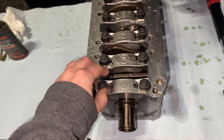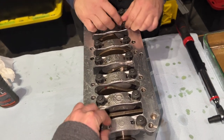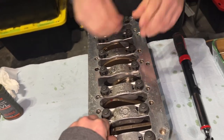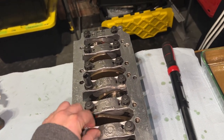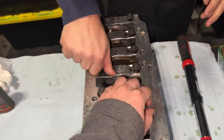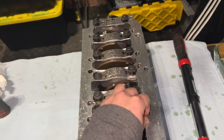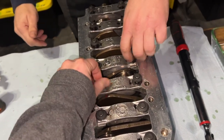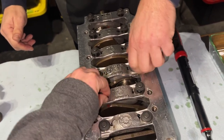So you first torque this to, I believe, 50 newton meters, 11 foot-pounds, and you should definitely look at your own specs. I don't think 50 newton meters is 11 foot-pounds, is it? Did I go backwards on that? 15 newton meters, 11 foot-pounds. Oh, 15, okay. I thought you said 50, sorry. No, that's 15, the initial one. And then what you have to do afterwards is 110 degrees. It's weird, but that's what you do. 110 degrees after the 15 newton meters.